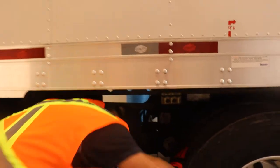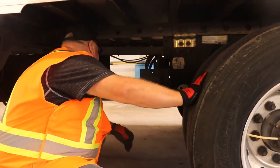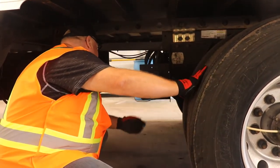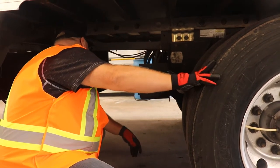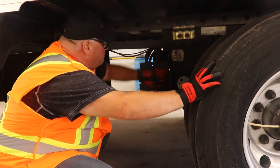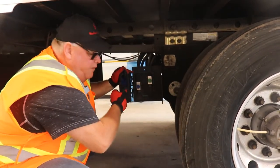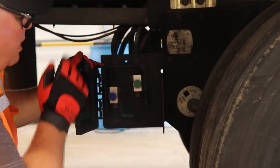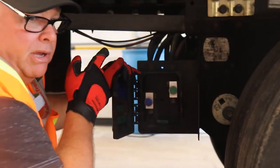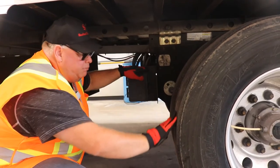You're going to look under here. You're just going to do a physical look underneath the inside of your wheels, any air lines, anything that looks like it might be chafing of any kind, okay? You're checking your tires from in under here, okay? You're checking your slide box for your dump valve to lower your air ride, and for your bogey rail pins for sliding your wheels. Make sure everything is good in there. Always make sure you keep this box closed.